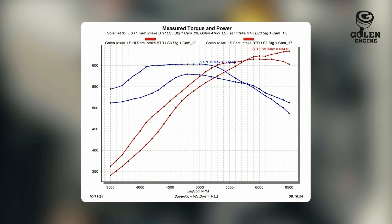The next thing I want to look at — I like to compare the Fast to the Holley Hi-Ram just to see peak horsepower. You can see the Holley Hi-Ram made power at a higher RPM — it looks like it would produce power a few hundred RPM past the Fast intake, which is typical because the runners are much shorter. And then you see a huge torque drop off: about 580 foot-pounds of torque versus 600 foot-pounds. And you see a lot of torque loss even down low — at 3,500 RPM you're about 510-515 versus about 545. So there's a significant torque loss down low.